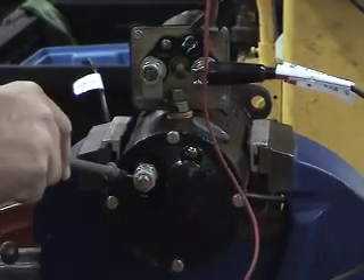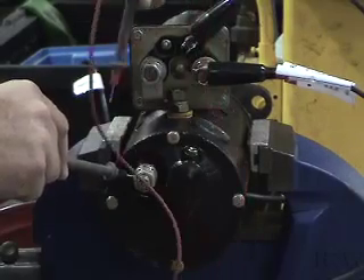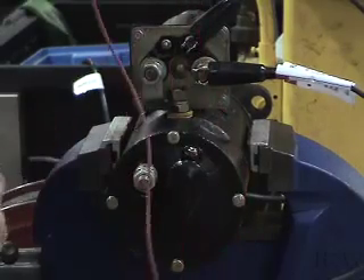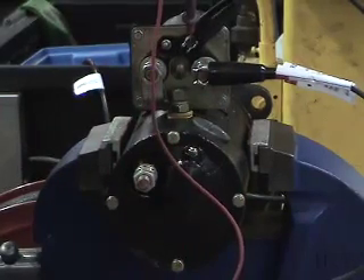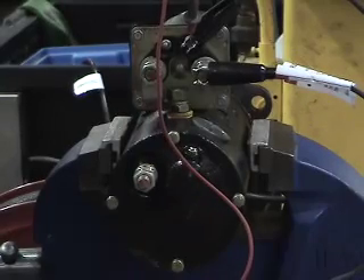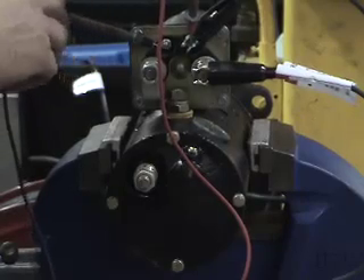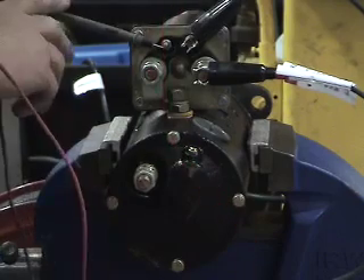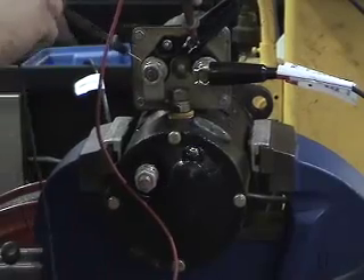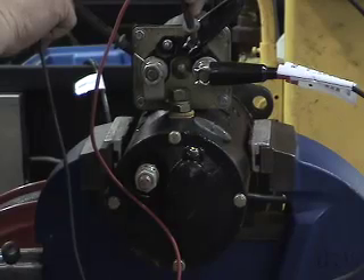The main current goes from your battery terminal in through your solenoid, across the contact disc, and out back through the starter motor. If you wanted to check the voltage drop across your hold-in winding, you would go from your S terminal to your solenoid ground terminal — that measures just the resistance of your hold-in winding. To measure the resistance of the pull-in winding, you would go from your S terminal to your M terminal.